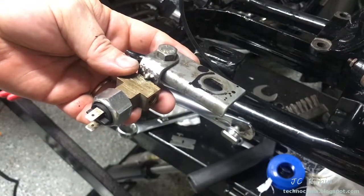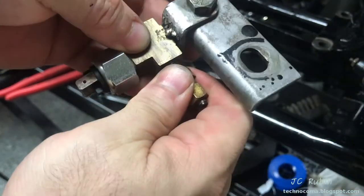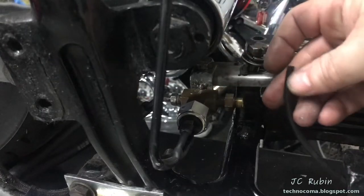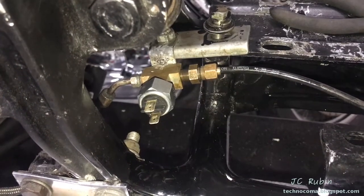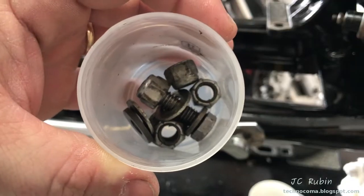It's coming along - now we can reintroduce the fitting. I reconnected the rear line and then temporarily the electrical cable just to check how it fits. Finally I re-terminated the front connection. I'm pumping the brakes and it's leak-free - everything's working fine.